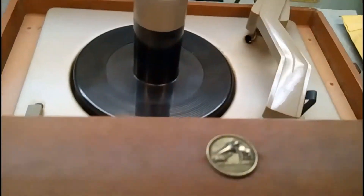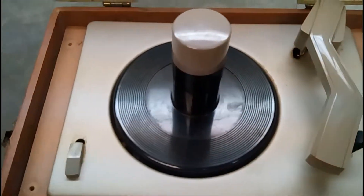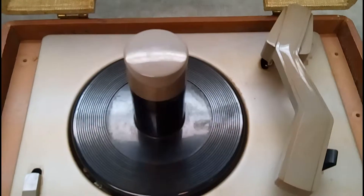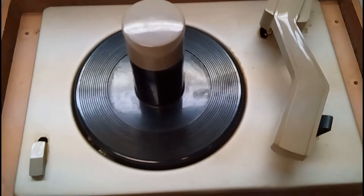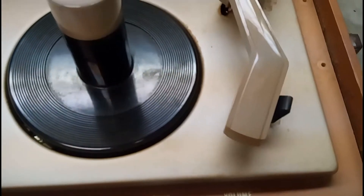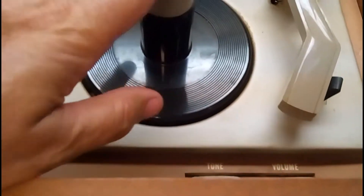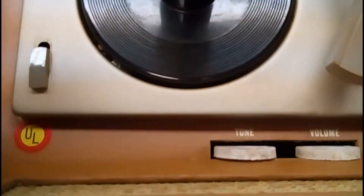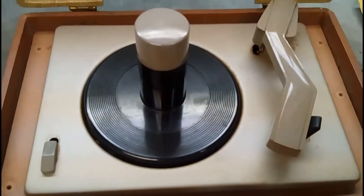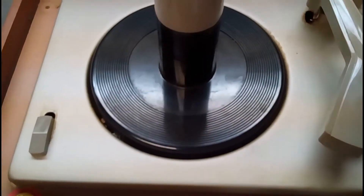I've connected it up and it has a loud hum. I've already taken the screws out and accessed the drive mechanism to look at it, which is in good shape. This one is already sold, so we're going to do the basics for the customer — clean it up, put in a new diamond needle with a metal cantilever, a new cartridge, dry oil and grease, clean all mechanical parts, service the electronics, and replace the capacitors and any burnt or changed-value resistors.